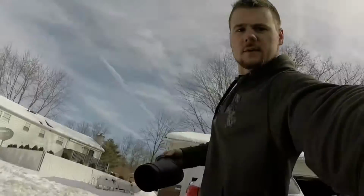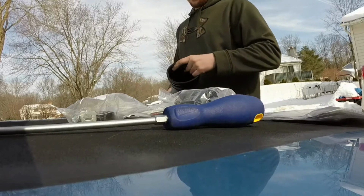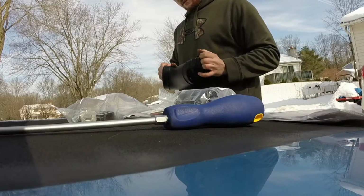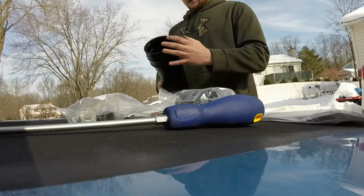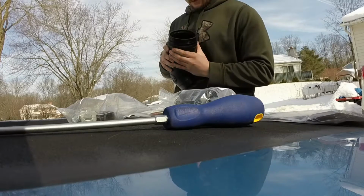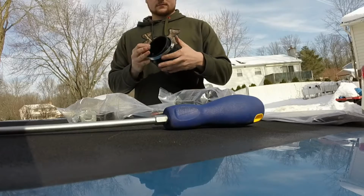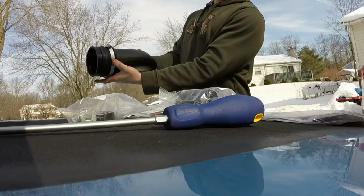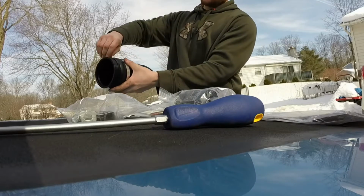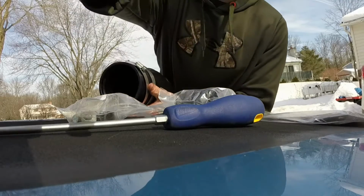That's it. So now you need to grab the other 2 intake pieces right here. So this bigger rubber grommet here, that's going to go around this end of the intake. They call it the hump tube, hump adapter. Just going to slide over like that. This is going to be the part that goes into your intake manifold, turbo inlet manifold. You're going to have one of the 72 clamps, the 2 remaining ones go on here. Tighten that one down, and the other one is just going to sit on there for right now until we connect the other parts.